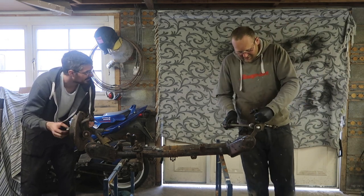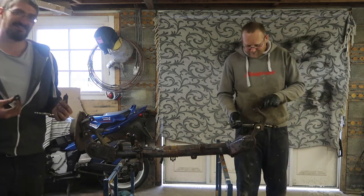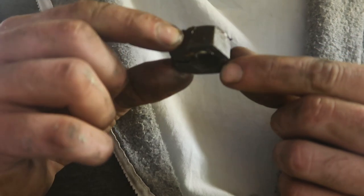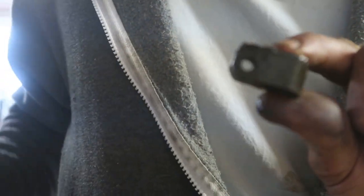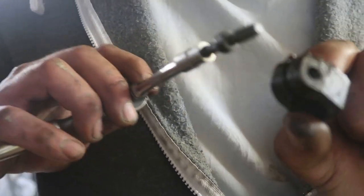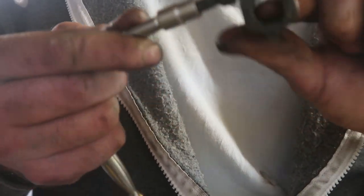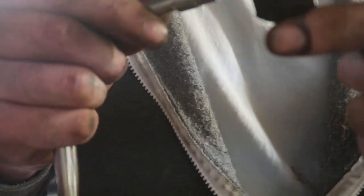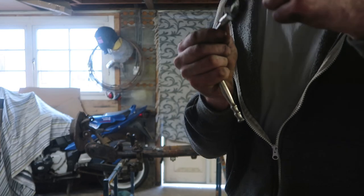I imagine a castle nut would have been easier. No, it's not a castle nut, is it? Cheaper to produce. But you sure? Okay, so it's a regular nut, but it's got a space for an Allen key to come through, and it pinches the bolt down so it doesn't back off. It's basically a fancy lock nut, but I thought it was just a nylock or a castle nut.